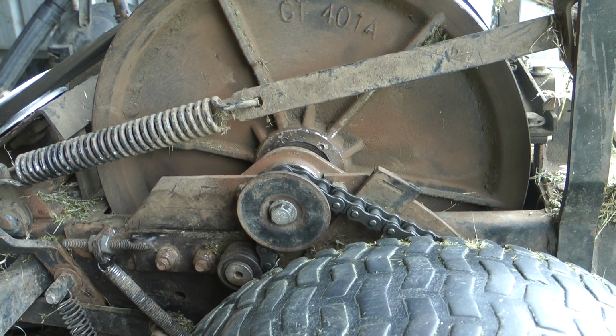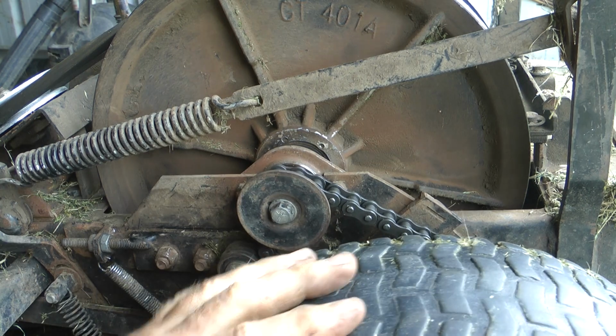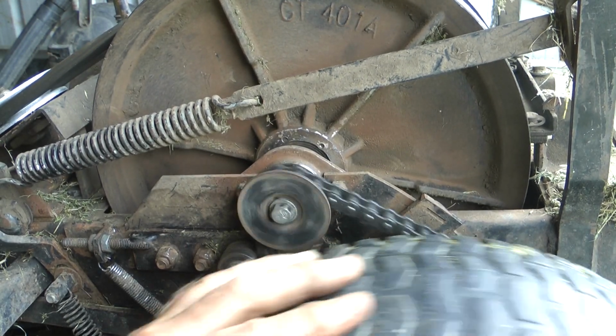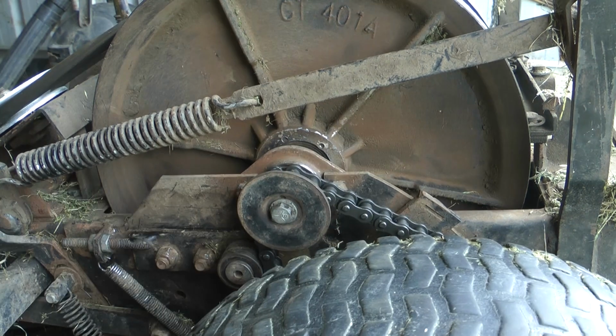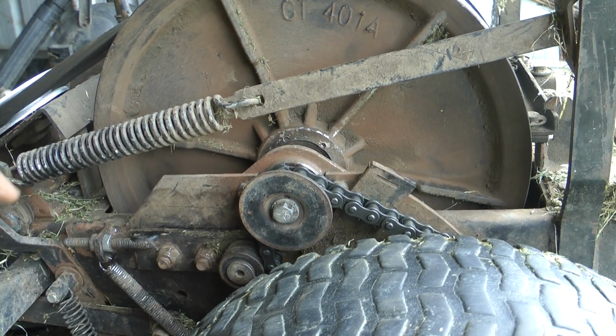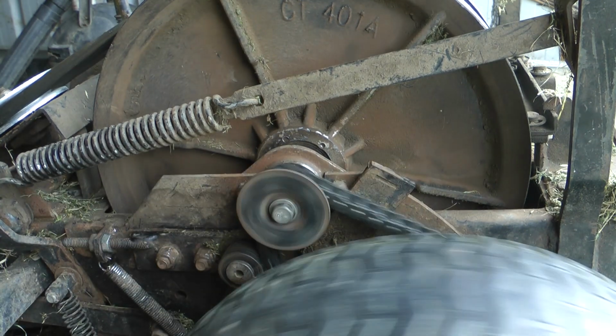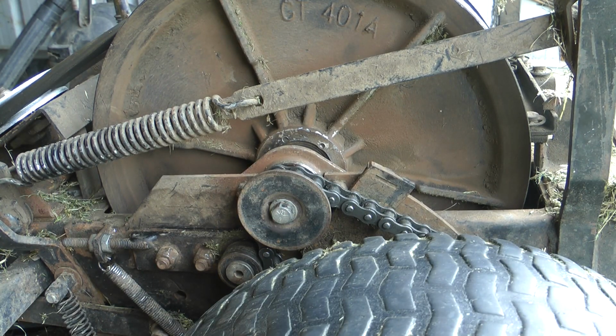See, now the brake lever's gone down. There, it's hitting the lugs on the back plate. Now it's off. This is not in the road back here. No brake. So I'm going to lubricate this, give it a bit of a spray, so it's nice and happy, and away we go.